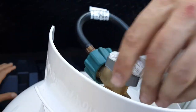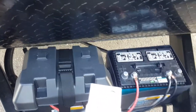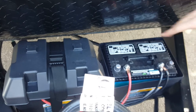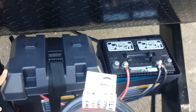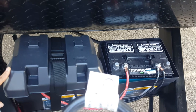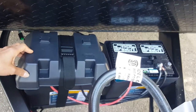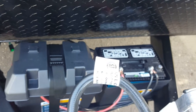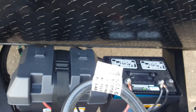These are your two Group 24 batteries — the same exact battery in each. These are your main source of all 12-volt power, which runs most things in the unit. These batteries will charge when you're hooked up to your vehicle while driving, or when you're plugged into shore power. There's a monitor inside that will show you where your battery level is.